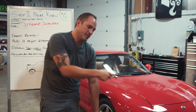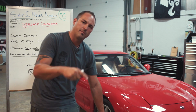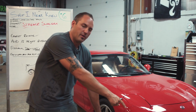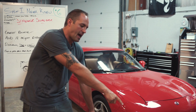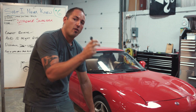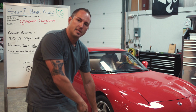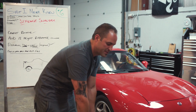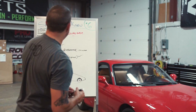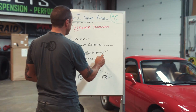A lot of times what I'll do, because the rears are harder to find, pretty much the fronts are always made because they're the same ones when people run a square setup, the same size on all four corners. It's usually that front size. So I always look for a rear wheel first. If I know I want a 20 or an 18x9.5 between plus 20 and plus 30 offset, I'll go on the website and I'll look for the rear first. Once I find it, I save that, and then I go and find the front in the 18x9 that I'm looking for in the rough offset that I need. So that is how you put the two together, and then you end up with a complete set that you can actually run together. And remember, it has to be in your bolt pattern, so I also sort by bolt pattern right off the bat.